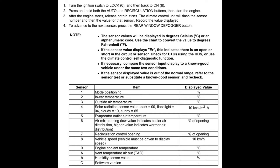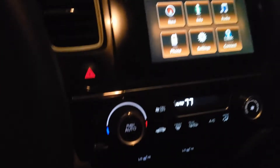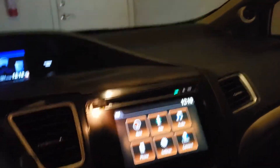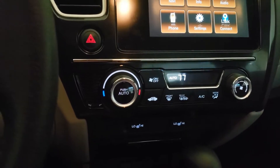Here is the list of sensors in the service manual. Each sensor has its number, what it reads, and what unit it displays that information in. Note that the ones that display temperature can output a negative number — that is handled as shown in this table. So I'm going to open my garage now, and we'll actually test this with the car running so you can see the evaporator temperature drop.